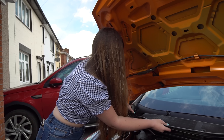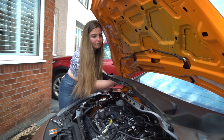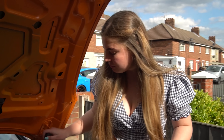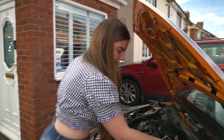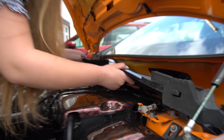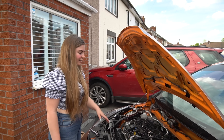Then the top part will come up. Moving on to the bottom part, there are five bolts — I've got a 10mm and I'm just going to undo them. We've got this tray which needs to come off — we've undone the bolts and there's a coolant line, so we need to remove that. I'm going to push it over to the left and pull this tray out. Now that tray is removed, we've got access to everything.